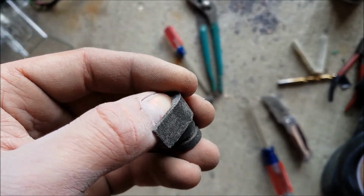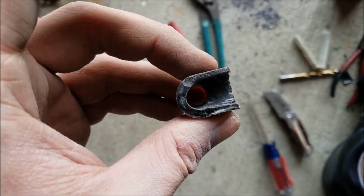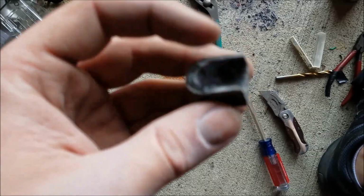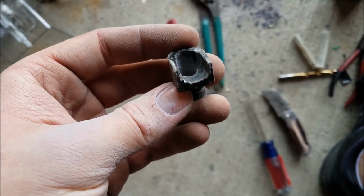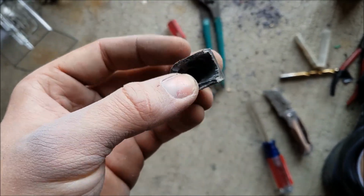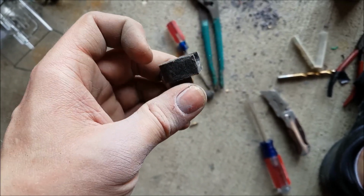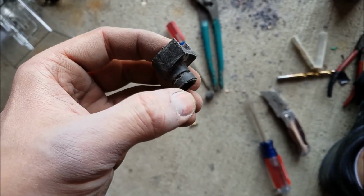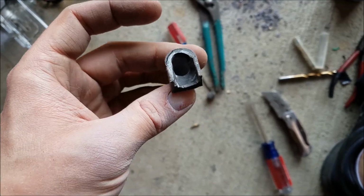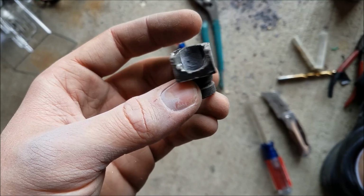I don't know, because it's all encapsulated. I don't know if there's an air pocket or what. Corrosion maybe, who knows, but the ground wire inside of this was bad. So unfortunately, with grinding this down to get the wires out, I did have to destroy the wires, so I couldn't see the condition of them once I opened this up. But now I could put new wires in here doing a 90-degree. I'm not going to do any solder joint inside of here. And then I have encapsulating epoxy that I'll be putting on as well.